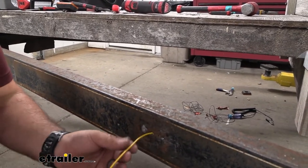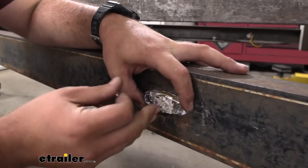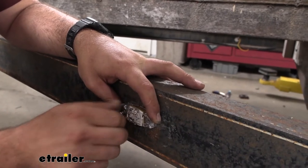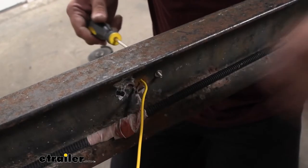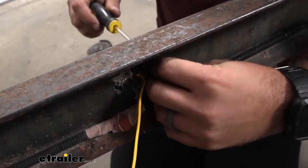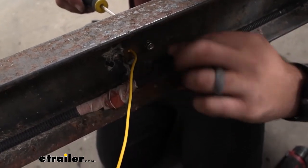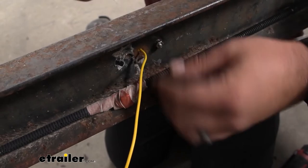Now we can pass our wires through, make sure our ground goes on that edge there, and with your hardware go ahead and get this mounted up. I'm using a washer here to give it a little bit more protection — that way if you over-tighten, at least that washer is going to disperse that pressure and it doesn't crack our light. I'm going to put a flat washer and then a split washer before putting our nut on, and that's going to allow this to hold in place long term and not rattle loose. I do recommend getting some stainless hardware so it doesn't rust and corrode over time — good hardware makes all the difference.